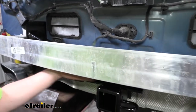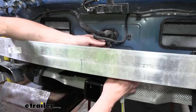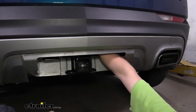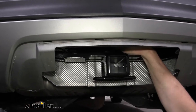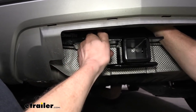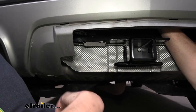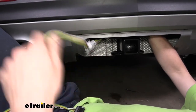Just like you were doing this underneath, you feed your wiring up and plug it into your connector. I'm going to feed it up and plug it in up here so you can see it more easily. The two will mesh right together — it'll plug in. We reach up, grab the connector off its little bracket, pull it right off, drop the connector down, pull the lock tab back, press the button, and remove the cap. Once the cap has been removed, we simply plug in our harness and it just meshes right up — plugs directly in, click. We are good to go.